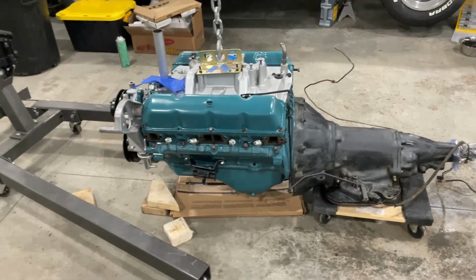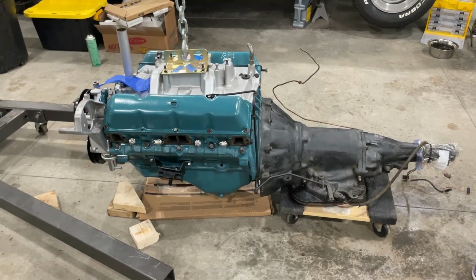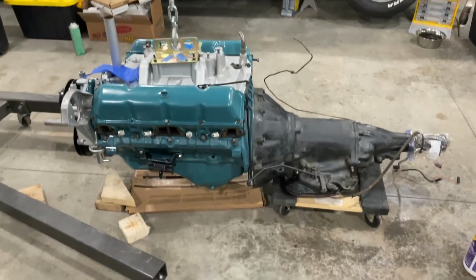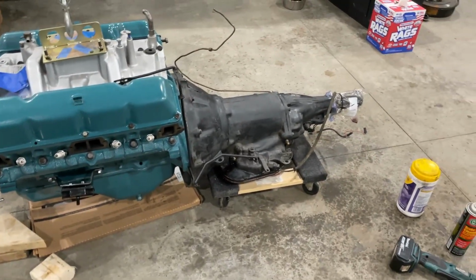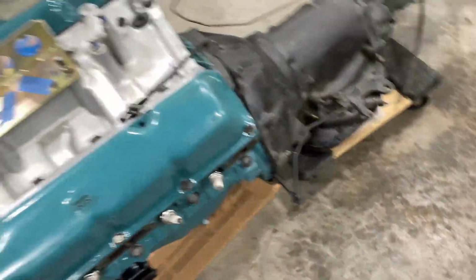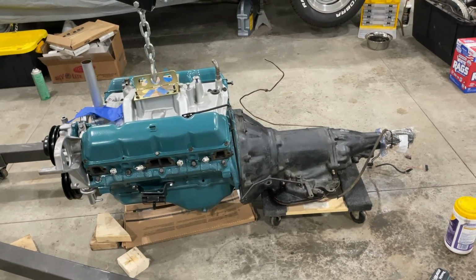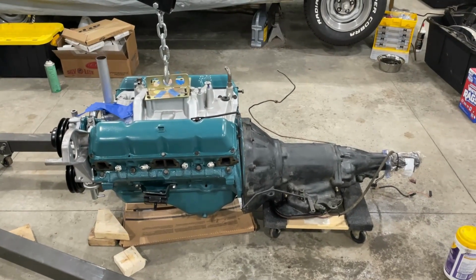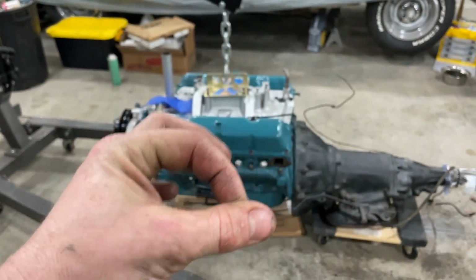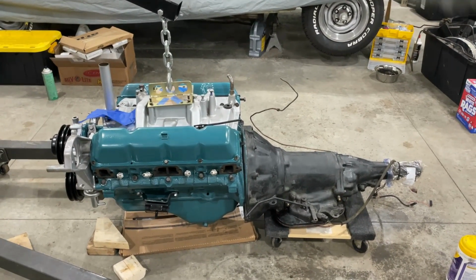Okay, here we are. Engine married to transmission. Finally. This thing has been apart for what? 4 months? Too long. Yeah, too long. So we had a little bit of a snafu with the torque converter. Sorry for the crazy angle, but AMCs are really good about only engineering things to go together one way. So we had the torque converter misaligned with the flex plate because the flex plate has a big locating hole, which I shoved the pry bar through to allow Steve to torque down the flex plate bolts.